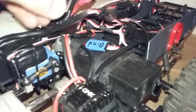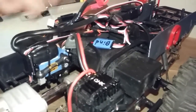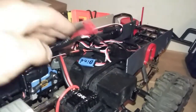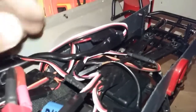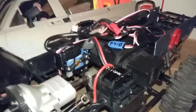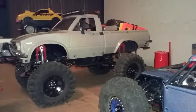So the main wireless winch is sharing power from my auxiliary one shift servo on a Y-connector. Speed controller is hooked into the throttle, steering is hooked into steering, and my bind plug is hooked into the bind port just in case something happens and I need to re-bind my radio. Yeah, it's still a huge mess of spaghetti under here and I'm really ashamed of all that — a bunch of whips and extensions and wires going everywhere. But let's hook this guy up real quick and see if she works.